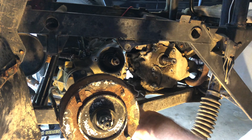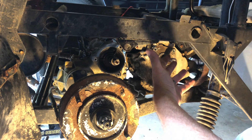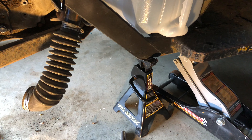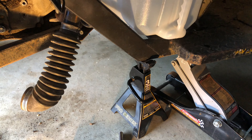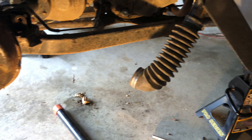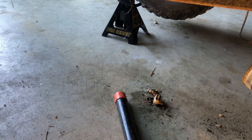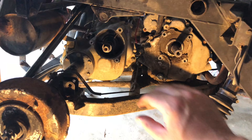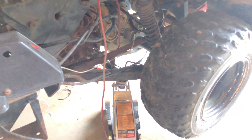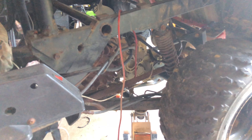I'm going to put my bolts back in there and the nuts to keep them secure. But before we do anything else, I'm going to have to figure out what to do with this — that engine is going to have to come out this way. So I've got to get this back down and get this up. I've moved my jack stand down to where the fuel tank was, and removing the jack stand over there is creating a little bit more room. Just by jacking this side up, we're creating additional room on the right side to pull the engine out.